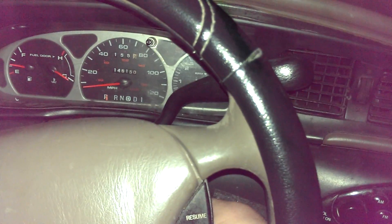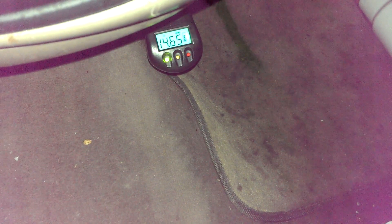Let's see what we got here now — I'll be cranking it. And she fired right up there. See the alternator voltage kicking in — 14.6. And this battery is completely discharged, it's going to need a good charge. It's a very old battery too. This is an Exide battery, back when Walmart used to sell them, from May of 2009. That has seen a lot of short trips. I'm sure it's got sulfate all over the plates now.